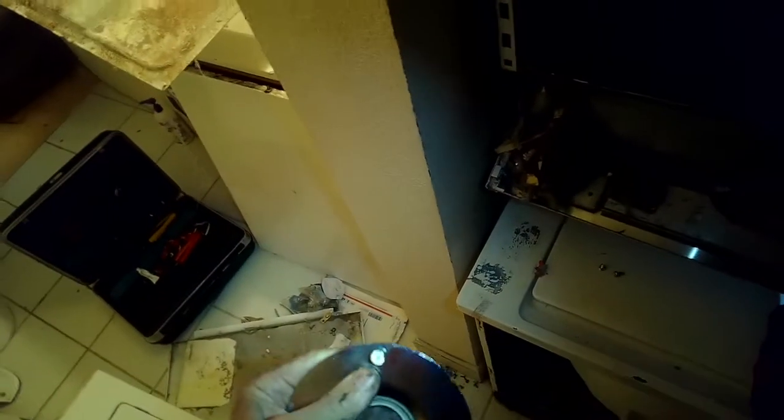So what we want to do is go ahead and add this new rear bearing to the back of the tumbler. It comes with three new screws. You actually have to kind of push the screws in to get them to start. And then it's now attached to the back of the tumbler with the three screws. We're going to set that ball down into that socket so that it's holding up the back of the tumbler. Then get the belt in position, reach down underneath, pull the idler wheel, rest the belt on top of it and pull it to the side — it's under spring tension — then put it over the motor pulley. Turn it a few times to make sure the belt's not going to slip off. Turn it a couple different directions before you reassemble.